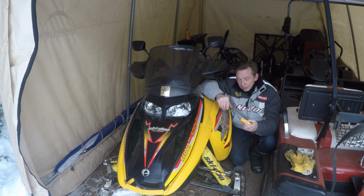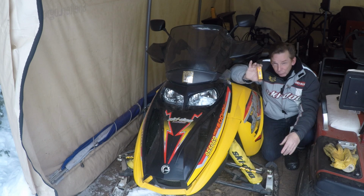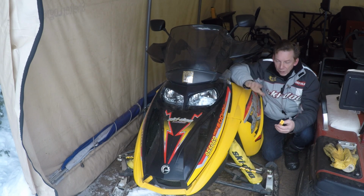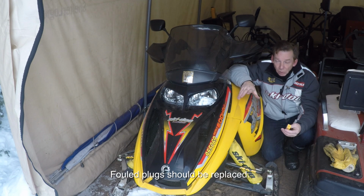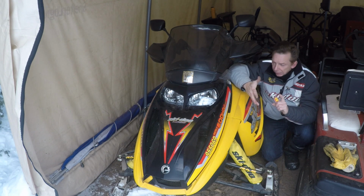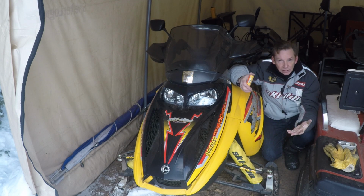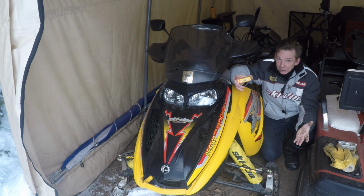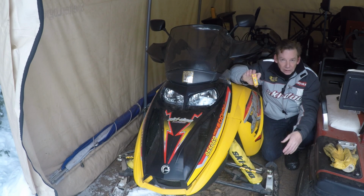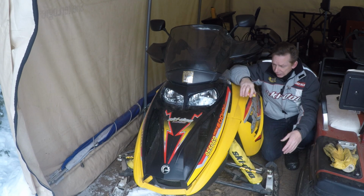All right, guys, one other thing I'm going to share before I put these spark plugs in, and this is my own experience, and I phoned NGK before I did this video and asked them the same thing. When you foul a plug, it's done. So I've taken these out and I've tried cleaning them in lots of different ways. I've tried electrical cleaner, brake cleaner, wire brushes, sandpaper. You take these out, you clean them, you put them back in, and you think, oh, there must be something else wrong. It's not a foul plug. Once these foul, they're done. Once the porcelain and the electrodes get contaminated, they're almost uncleanable, is what NGK said to me.